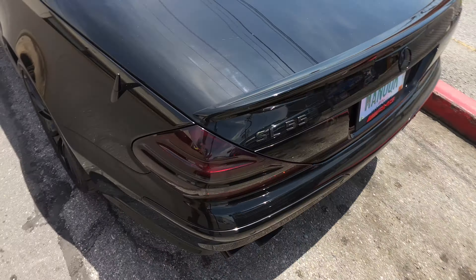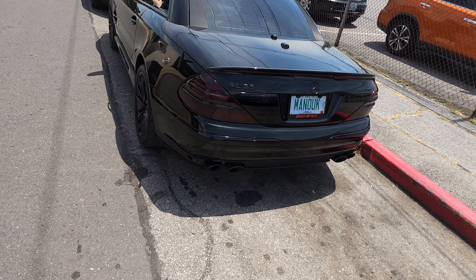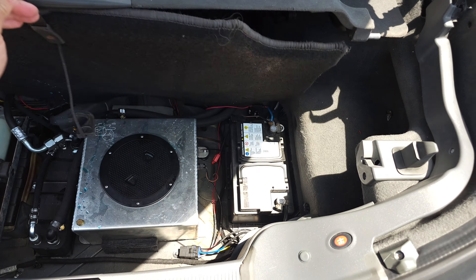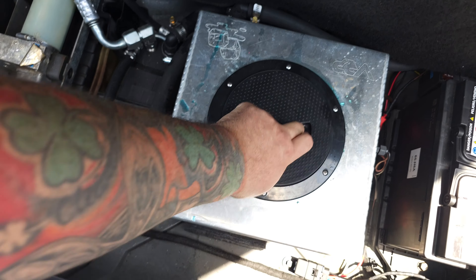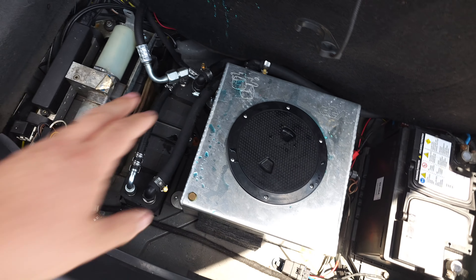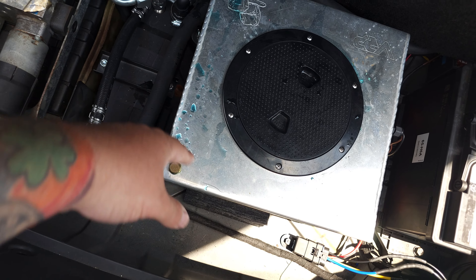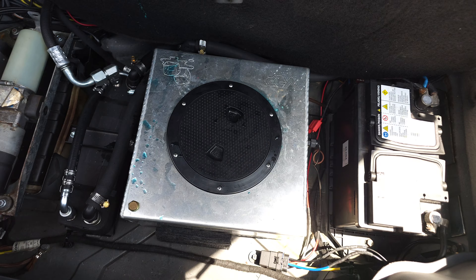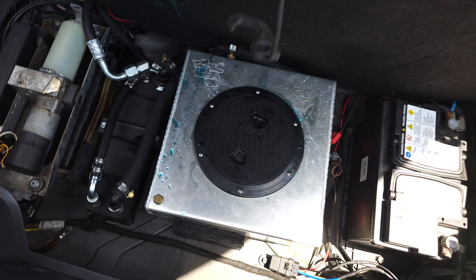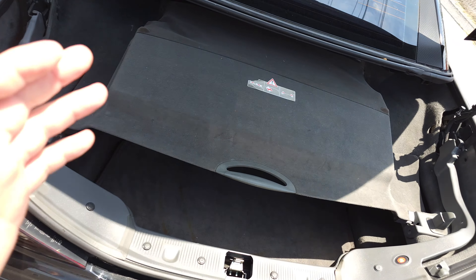Listen to these cams - literally made all that power with no boost. This is the ice tank setup on the SL, and damn, that is cold. There's no heat back here from an engine or anything. You've got this giant chiller that feeds the ice tank, sends it up front. The extra pressure from all the flow comes out of this. There's a drain in the trunk so you don't have to worry - if you threw a bunch of ice in and it overflowed, it's going to go right out the drain. Close this up and nobody's the wiser. You have an awesome setup back there - we love these, we want to do it to all of them. Hopefully the CL guy later will add a chiller too.